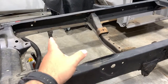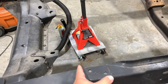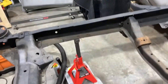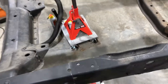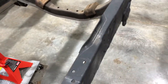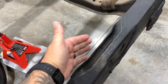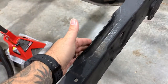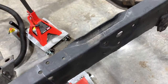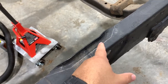We're getting ready to put an independent front suspension in here, which means another cross member is going in. We have to box in — put a piece of metal on the C channel on both sides. We've also got this big ugly hump here, an indentation from the factory for the steering box. They bent the frame from the factory to clearance for the steering box. That's not going to work with our independent front suspension, so we have to cut this out, and then weld in a new piece.